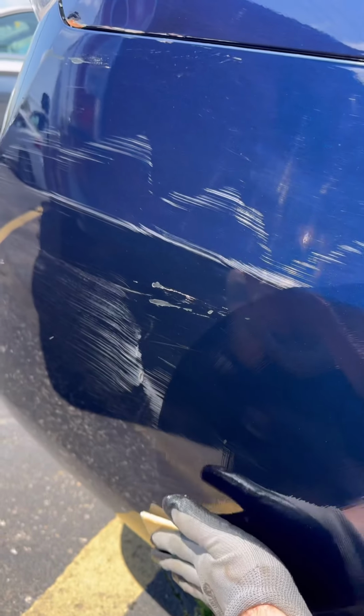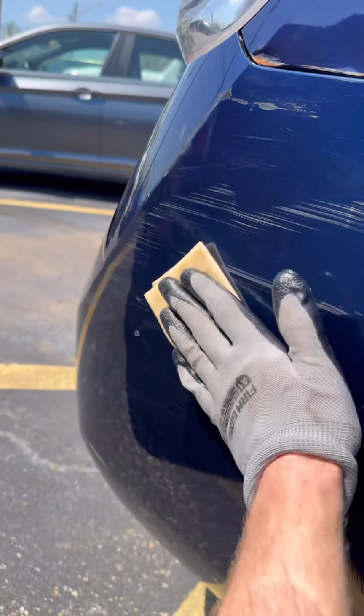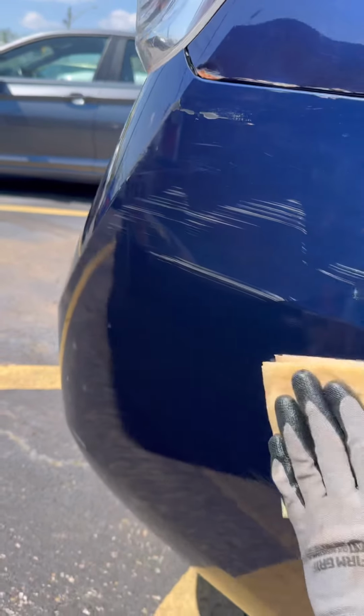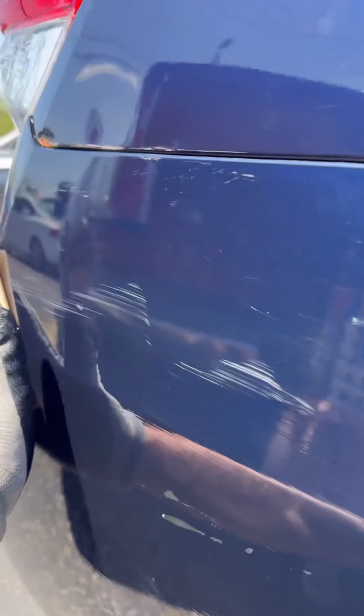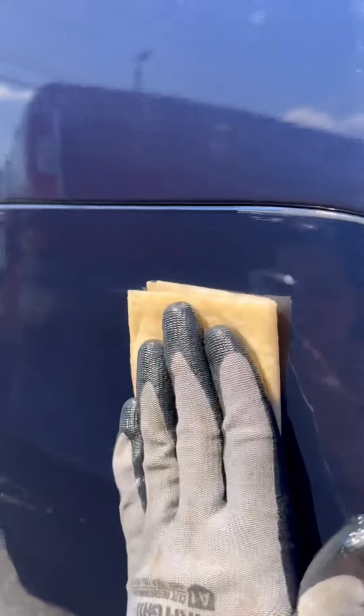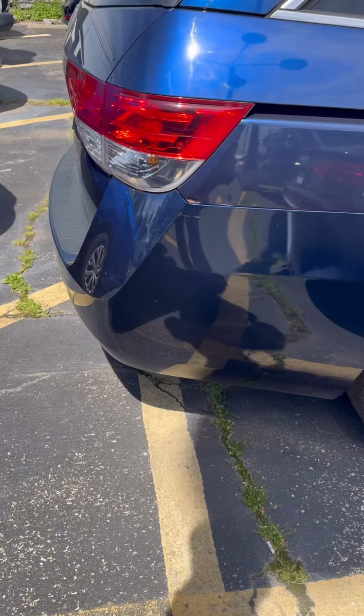So you could test the longevity of the coating with how much gloss is left after X amount of time. So that's how we test ours. After a year, the gloss retention was at 75%, which is a very good indicator that it will last over 2 years. If you get around 40 or 50% gloss retention and no hydrophobic properties, you might want to apply another coat just to up that shine and bring it back to new.